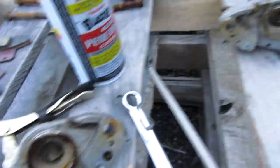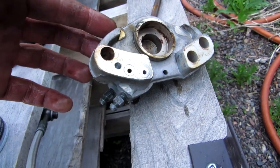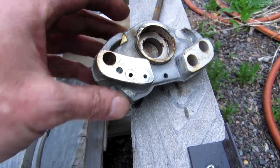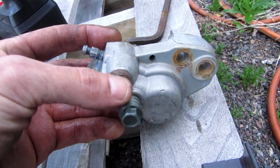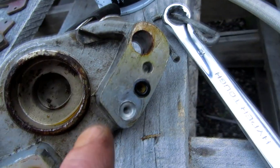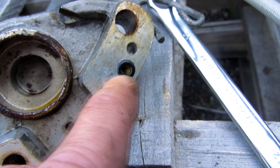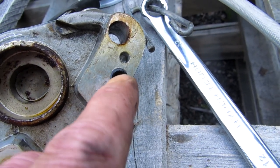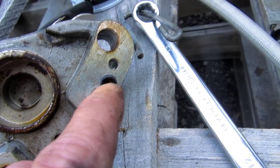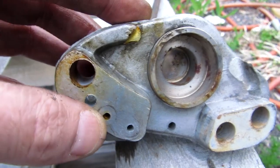So I decided to hack the whole thing apart, and I found that one of the chambers — this port right here — comes from that hole right there, and that hole goes over to where I had this connected. But once I pulled these two halves apart I noticed that the seal was all squished up in between these two points. This side was in but the other side was squished in there, and I don't think any of the brake fluid was getting through this hole. Looking at the inlet hole — it's got rust and gunk in it, which means that hole wasn't even being used.